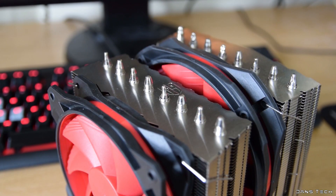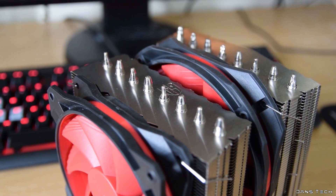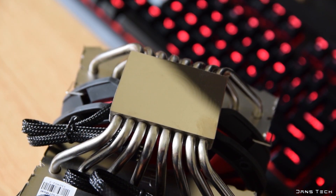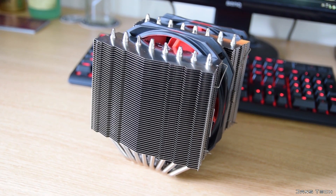The two towers feature many aluminium fins with a whopping eight copper heat pipes passing through the two fin stacks. This is the first cooler I've checked out with eight heat pipes, so it'll be more than interesting to see how it performs. Also the base of this cooler is rather large, so it should be great on larger CPUs like Intel's LGA 2011 processors. Overall the build quality is excellent and with the fancy design of the fin stacks this cooler does look very nice.